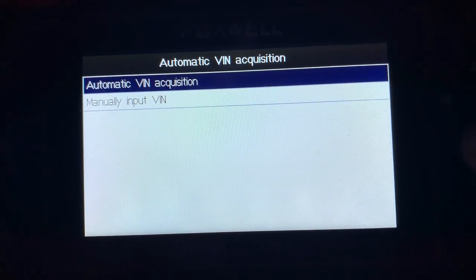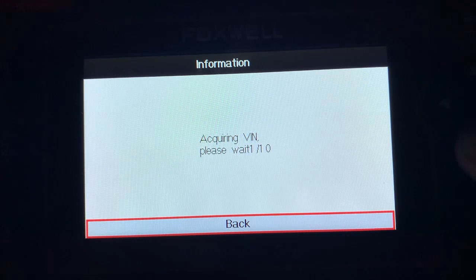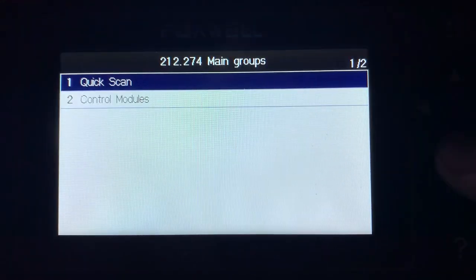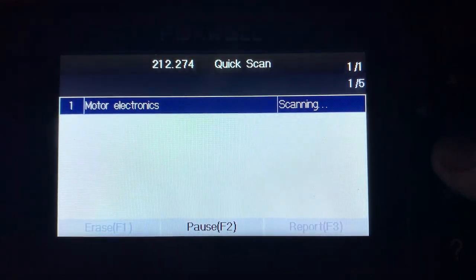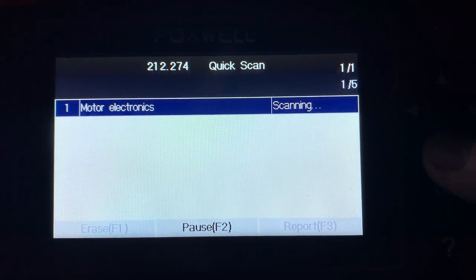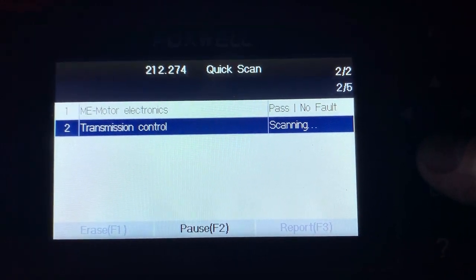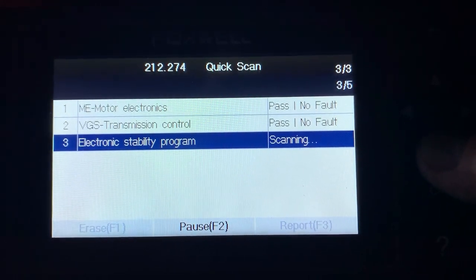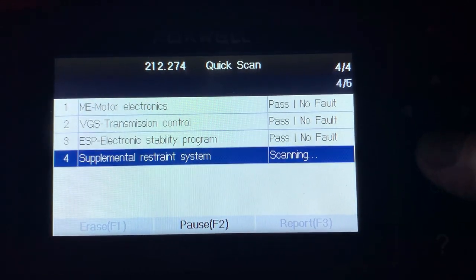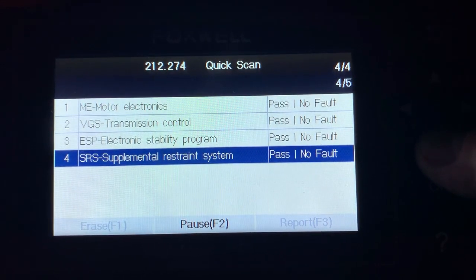Using it is simple, just like any other scanner. Connect the cable to the top, plug the cable to the car, and hit VIN read. It'll read the VIN and then you can press diagnose and it'll read all the modules on its own. Or you can select the car manually and select the specific module you want instead of waiting for it to do the whole scan. If you're only concerned with engine, transmission, airbag, or traction, the scanner is going to help you — and the cost of the scanner is typically what they would charge for one hour of diagnosis.